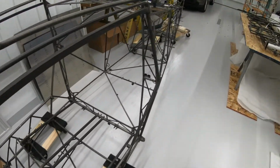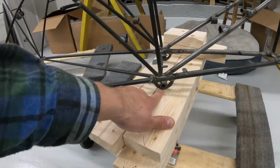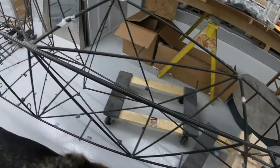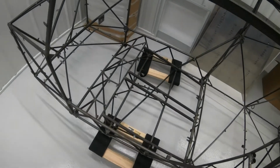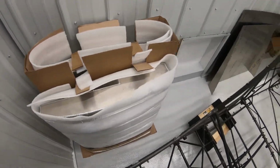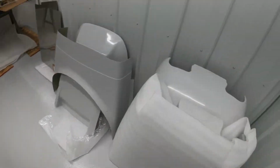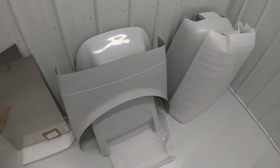Oh, and on the back, it's got this Super Stol. The mount, here's the hinge point for the Super Stol suspension on the tail wheel. It's going to have Highlander main legs, but I'm going to get them from TK1. Got two aluminum 13-gallon wing tanks, and Steve Henry is making me a 5-gallon header tank. It has the Rotax 914 cowling. I've been told that works best for the Yamaha Apex.